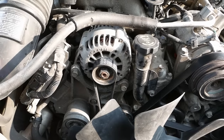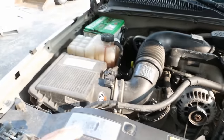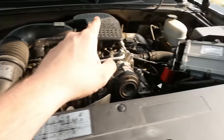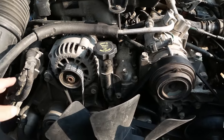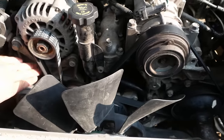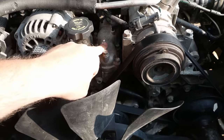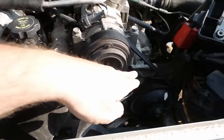The official procedure from GM is borderline insane. They want you to remove both front wheels, both front fender liners, the starter, the charge air cooler tube, and then strip the entire front end of the engine — the FICM, the alternator, the AC compressor, the power steering pump, both big accessory brackets. And then they want you to remove the entire thermostat crossover assembly, which goes from one cylinder head to the other cylinder head. You cannot get that done in six hours, not in our climate anyway.